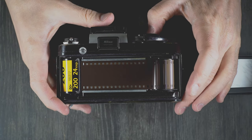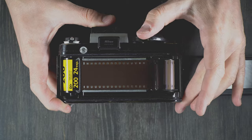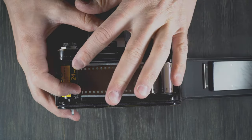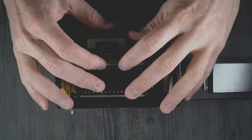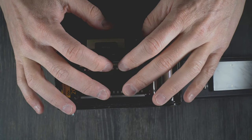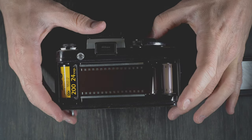I want you to see what's going on inside the camera when we take photos. The film that has not been exposed is pulled out of the cassette and fed across the back of the camera. You can see how the guide rails keep it from moving up and down, and through the sprocket holes you can see those inner guide rails. When the pressure plate is sandwiched up against here, you can see how flat it keeps the film.